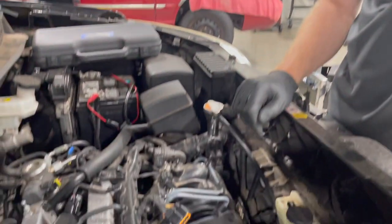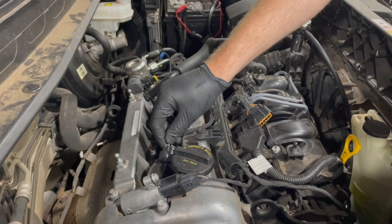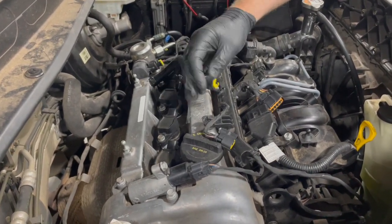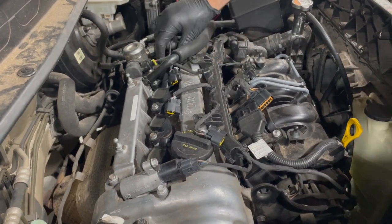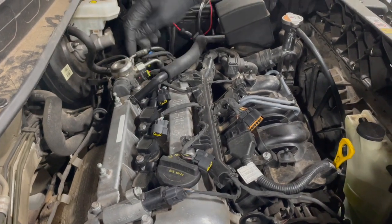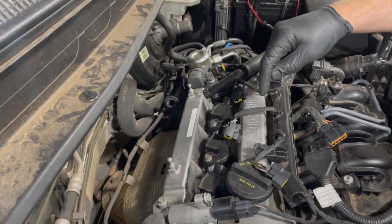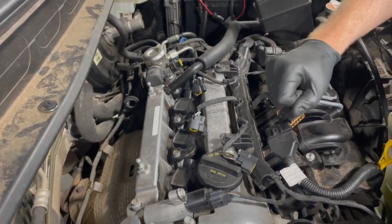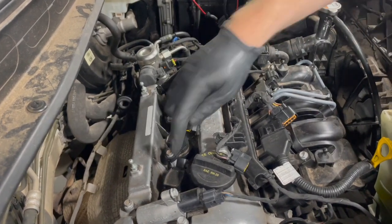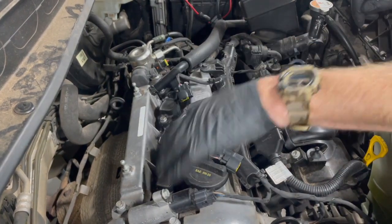You do want to make sure and disable the fuel one way or another. We're also going to disable the spark on this one — it's really easy since it's coil-on-plug, so if we unplug all four coils there's not going to be any spark. On an engine that has a distributor or older coil setup, you can try pulling the fuse or unplugging the coil. If you can't do any of those, you want to make sure and ground that spark plug coil wire to ground with a jumper wire, because you need that spark to go somewhere when cranking over.